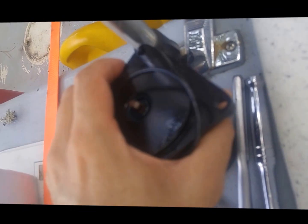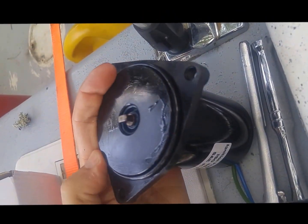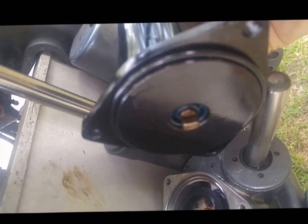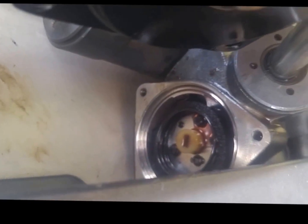To be thorough, put the O-ring on the motor, and then reinsert it. Require lining that notch up with the motor receiver, which is not like the easiest thing, but since you've got a little play, it shouldn't be altogether impossible. There it goes.